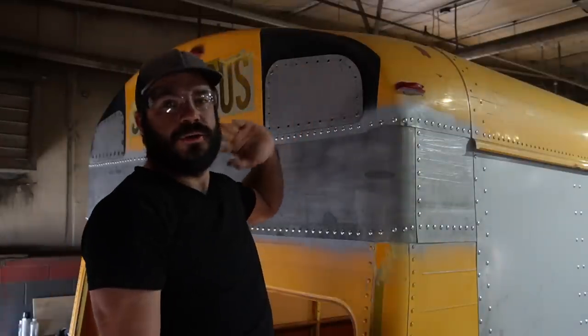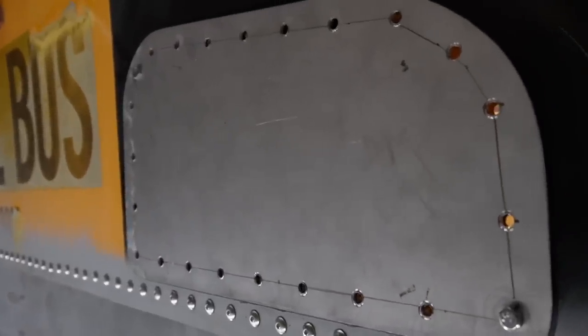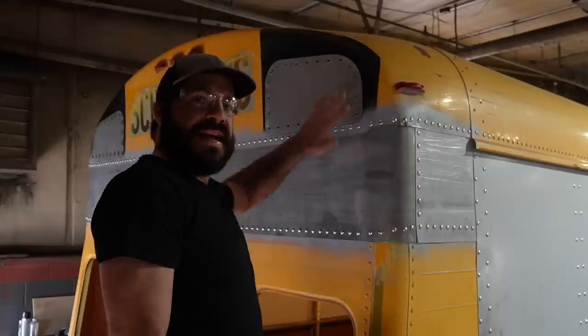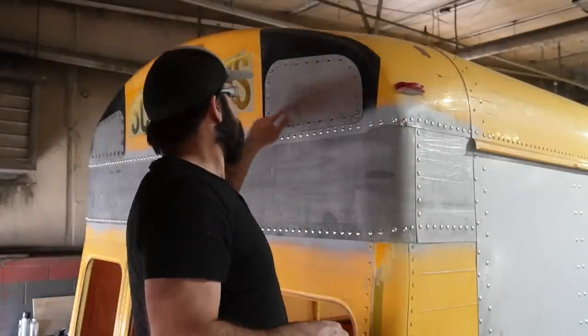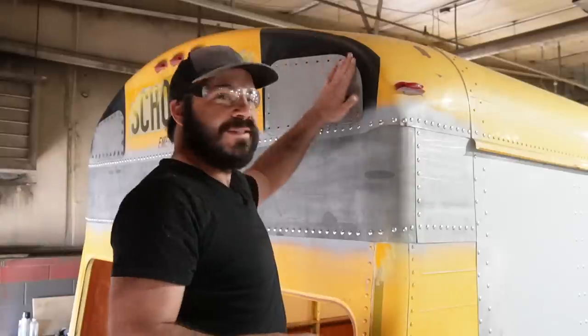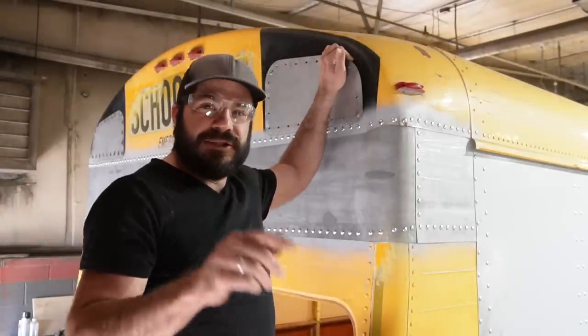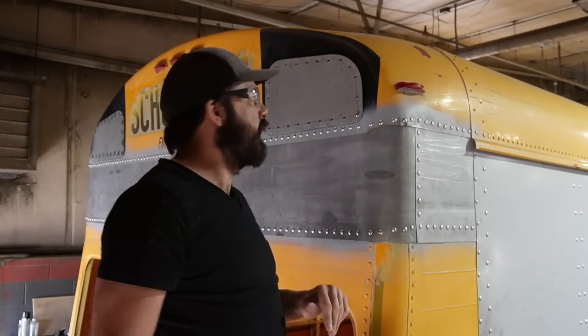Now that we've got our holes pre-drilled in not only the patch, but the cap here, I'm gonna go ahead and unbolt this guy. We'll wipe this down with some alcohol just to make it nice and clean. I'll load the back up with a sealant of my choice. I think I'll go with some ProFlex by GeoCell and shoot this on with a handful of quarter inch rivets.